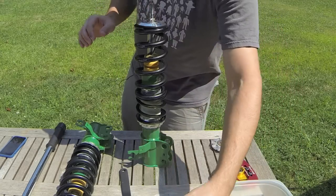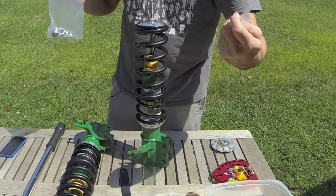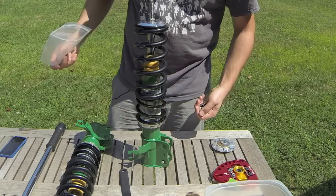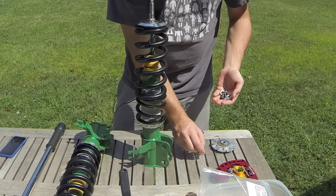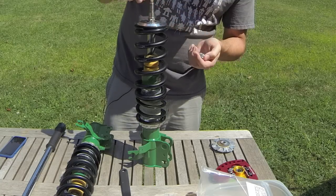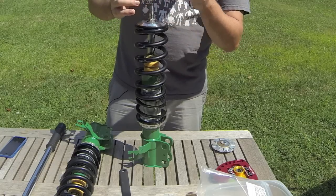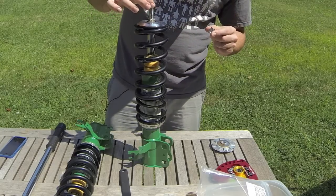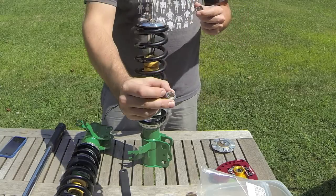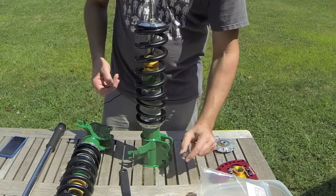T3 sent a bunch of kind of universal hardware, and I separated out the stuff I wasn't able to use. They had some top nuts — I think they were designed for the OEM-sized threads. I went and picked up a couple things, and this is the one that actually fits. Where the rest of them stop on the threads, this one actually goes down to the collar, so this keeps the top plate centered on the threads. There was another one that only stops about here. I've modified it so it doesn't go down as easily — I shaved off a bit of the length so they can actually stack together, because I use it to space things.